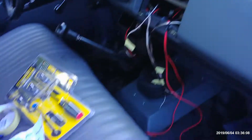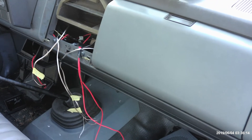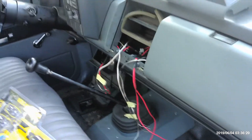The rear on the driver's side is brown and yellow — the brown is positive, the yellow is negative. The front driver's side is tan, which is positive, and the gray is negative. On the right-hand side up front, the green is positive and the dark green is the negative. So that's your wiring diagram.